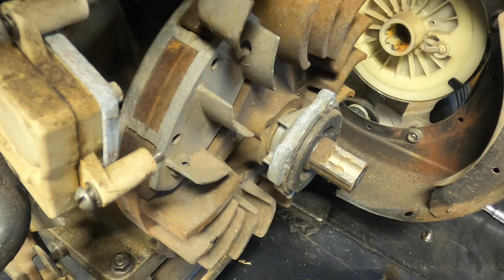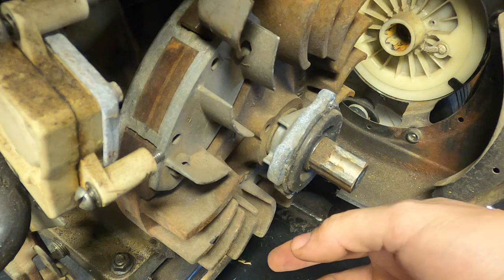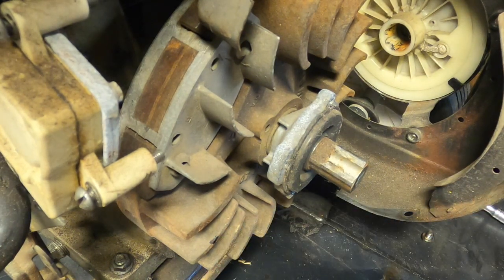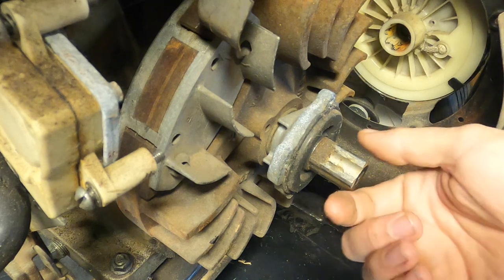Be careful — you don't want to put a lot of tension on it and you don't want to do it on the aluminum fins. You basically want to stop the engine from moving. You can fill the cylinder with rope, or if you have a piston stop you could put that in. If it's a flat head, which I'm sure the clutch is going to be on, I don't know how your piston stop is going to work, but that's how it is.